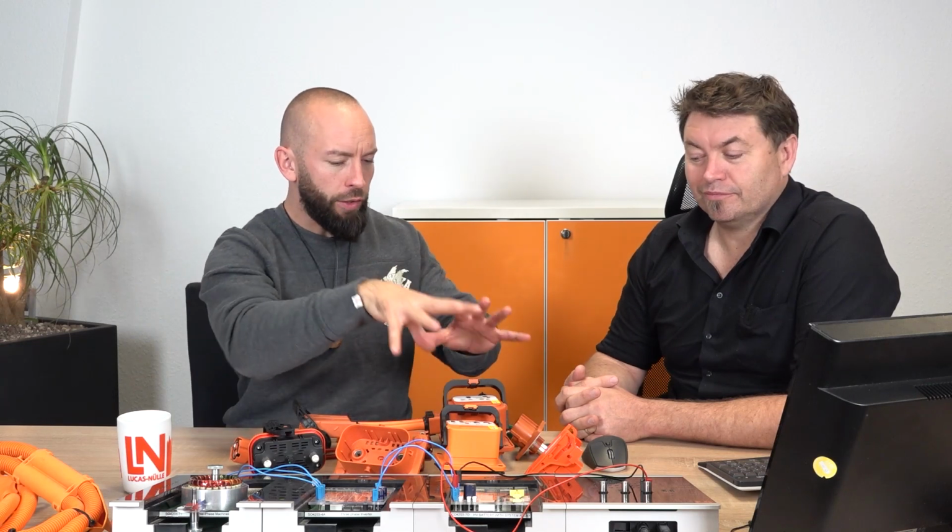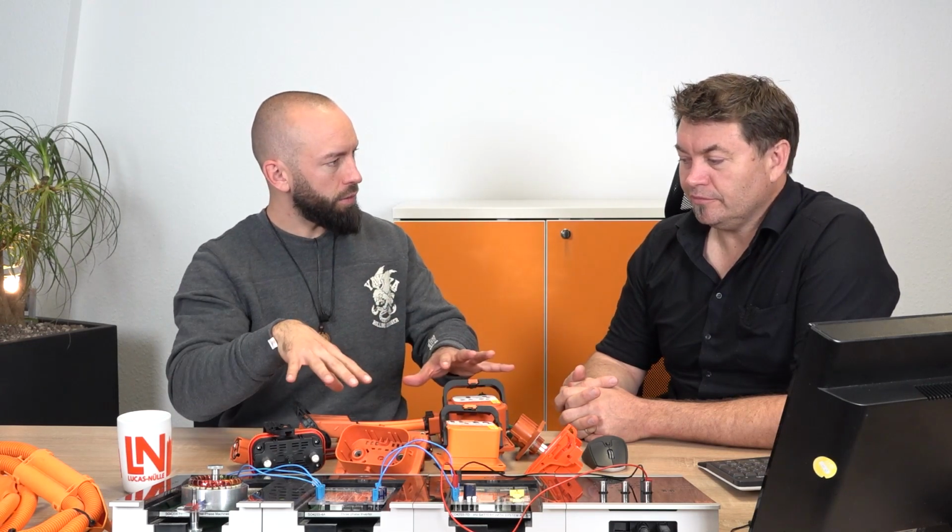Cool, very nice. I'm just thinking maybe we close the video with a very special case. We don't have to go into too much detail right now, but just so that we have mentioned it, as this is important not only for the workshop but also for the firefighters. We can do everything here, disconnecting or interrupting the interlock, but when the relays are welded shut, we cannot shut down the vehicle, right?